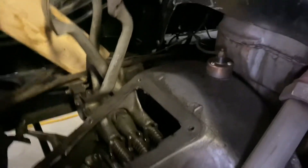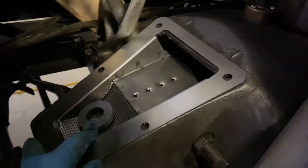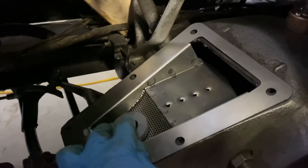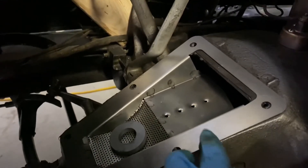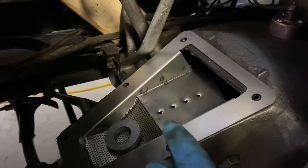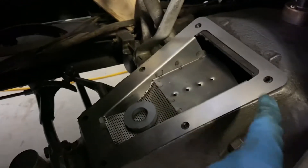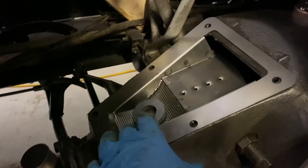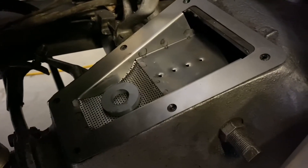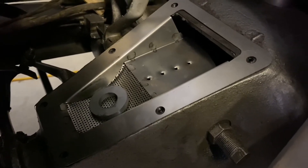What we've done is add an aftermarket filter — there's no factory engine filter and no transmission filter in there. This aftermarket unit has a screen that allows oil to splash up through it, and a magnet to catch any metal burrs from normal engine wear. The screen also allows oil to sink back down through. Those bands are typically cotton, though modern ones are Kevlar. As they wear and push along those drums, pieces come off and create a fluff in the oil, which this screen will catch as well. The engine oil is shared by the transmission, so it's one oil for all systems.